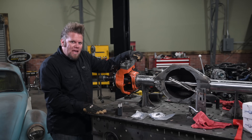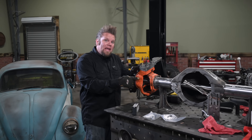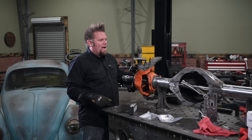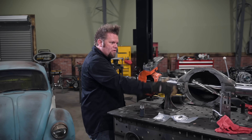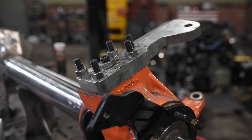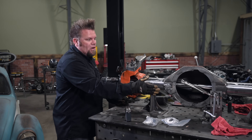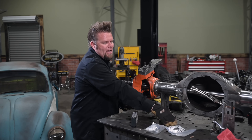I put the axle up on the fab table. This is a Spider Trax housing with Reed Racing kingpin outers — I just had them laying around on the shelf and I kind of like the style. It's that old-school kingpin top, kingpin lower. I've got my alignment bar in there, and what I'm doing is basically setting the face of the axle at zero — straight up and down — and then the knuckles I'm kicking back 17 degrees of positive caster. That means when I put it in the vehicle, the pinion will rotate up 10 degrees and these will have 7 degrees of positive caster. It's just easier to set it up straight up and down with the table and the bracket.